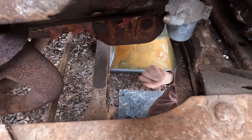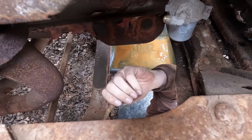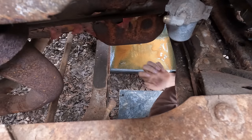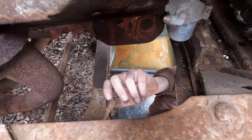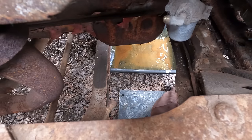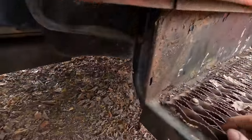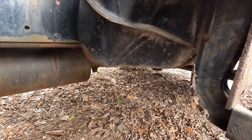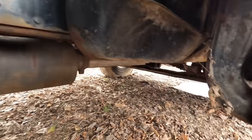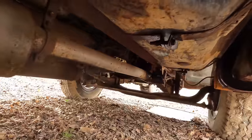The line is clogged up solid. I guess I'm gonna have to run a whole new fuel line, because it's way too long to try to fish a wire through. I think the only other thing I can maybe do is spray a bunch of penetrating oil in there and hope it breaks down the clog. I kind of doubt that'll work. Well, apparently that was an epic fail. The fuel line is obviously completely plugged solid with varnished gasoline, which I have seen several times in the past.